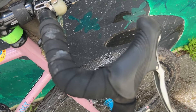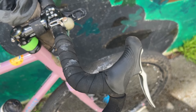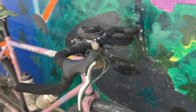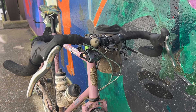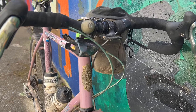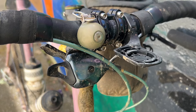I'm actually going to be swapping out the whole group soon because that derailleur is so messed up. I'm going to get some Microshift Advent, and kind of ruin the aesthetic of the bike unfortunately, but it'll work a lot better. And that's how I use the mountain bike group — the Paul SRAM Shifter Adapter, the 31.8mm adapter. It's kind of weird, but it works, and it allows you to use a mountain bike group on a drop bar bike.